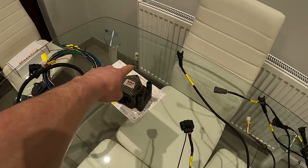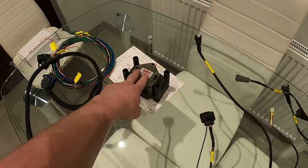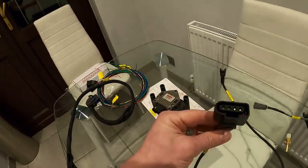Although this one says KMS on it, it is a Volkswagen coil pack — search 'VW coil pack' on eBay and they all look like this. Stay away from cheaper brands — try to get a Delphi, Bosch, or something more branded. A decent one can be had for about £30. If you really want, you can use standard blacktop Zetec leads — they just about reach. Or, search on eBay for 'Audi A2 petrol HT leads' — there's a seller in the UK who makes them and they're a nice length for a Zetec, push right down into the plug valley. He's got about 24 colour options. It's worth putting new leads and a new coil pack on anyway before you hit the dyno.